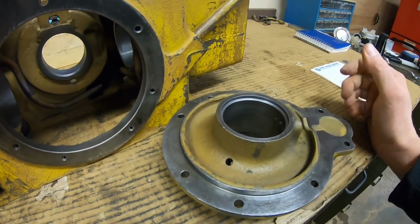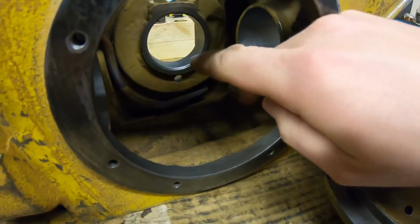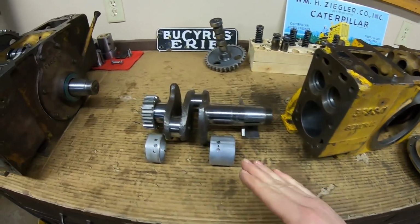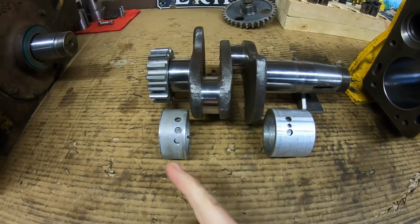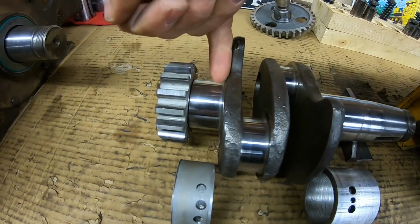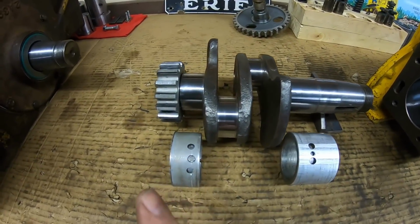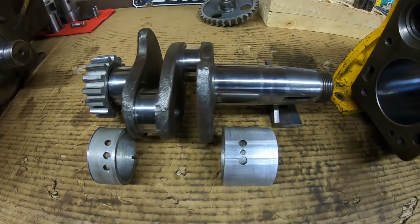Back from the Shepherd lathe now. So we've got our steps cut into the rear cover and into the block. And the reason why we cut those, well, let's look at the original design for the crankshaft bearings. Each one was just a straight through sleeve. All the thrust was contained, of course, on the front main between this web and the gear with the seal washer. To split it, I'm gonna make two new bearings, each one that has a thrust flange on the inside